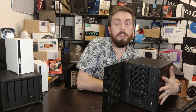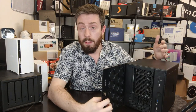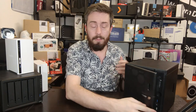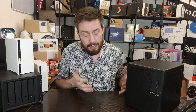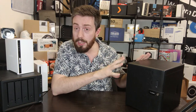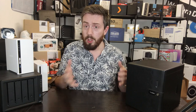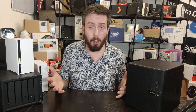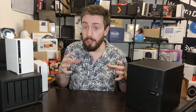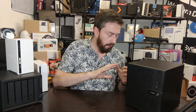On the front there's full ventilation, a power button, and LEDs for system and network health. Notably there are two USB ports on the front, which can be used for raw storage or USB backups. TrueNAS version 12 has a huge range of supported storage. There is a lack of M.2 slots and things like U.2 and SAS-based ports on this pre-made solution, but TrueNAS itself is completely open source and custom — you can build whatever you want. TrueNAS also has a Fusion Pool system for combining different storage media to their inherent benefits, comparable to QNAP's QTier.